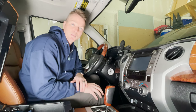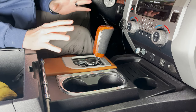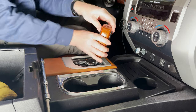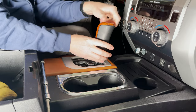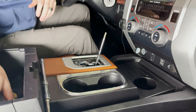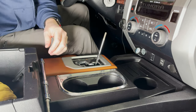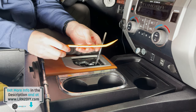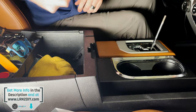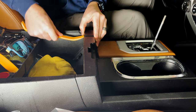To take it out, it's actually really simple — there's just a few steps. I highly recommend that you disconnect the power from your battery first, just to prevent any issues. Next, we're going to take the shifter and just remove it like this — just thread it off. Once that's off, if you have some pry bars, these are actually a really cheap kit. I'll put a link in the description below, and I'm going to take one of these pry bars and start to pry this part right here away.